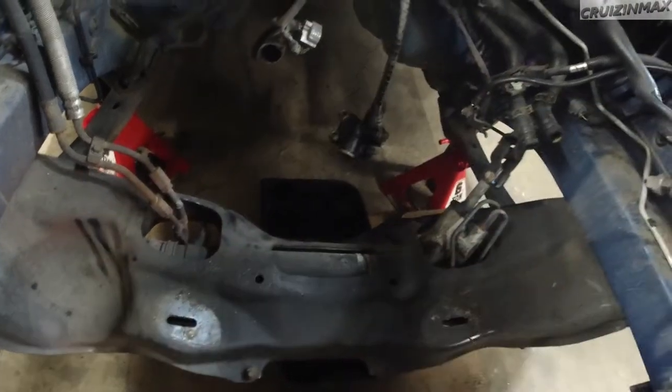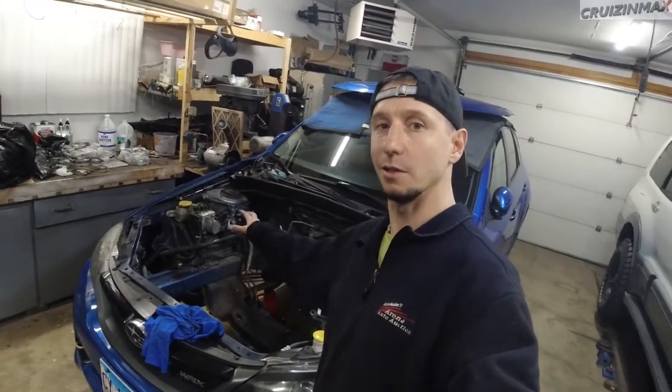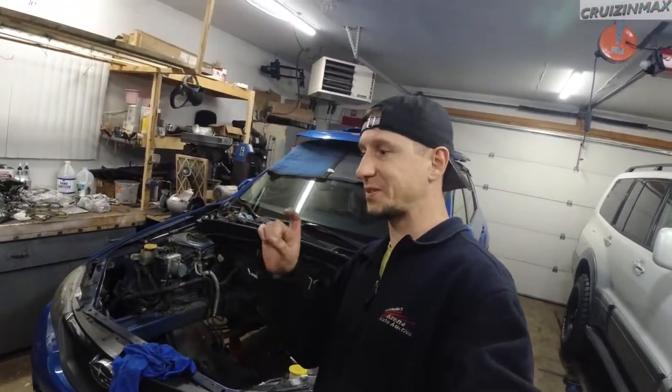That's all. So we took some stuff off the engine. We already switched the clutch slave cylinder so it doesn't drip, and now we're waiting on the new engine to get built. So actually, I'm not sure what's going to be next. I'm probably gonna start with mounting the differential. We're gonna open it up, clean it out, because it's actually missing the breather right on top. This guy here. So I'm sure some stuff got in it. So rear cover off, we're gonna clean it. We're also gonna take care of this dirty, nasty engine bay. Give it a refresh.